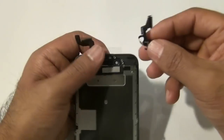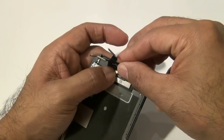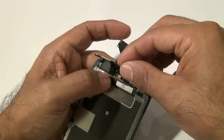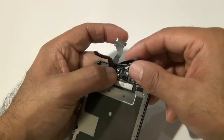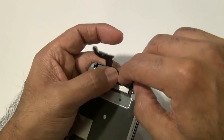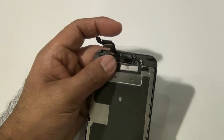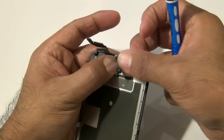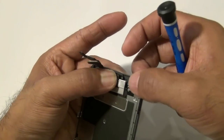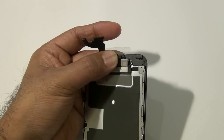With those seven screws in, start working on the front camera proximity sensor bracket. First, lay in the little microphone on the bottom — note there are little hole cutouts in the flex cable that need to line up perfectly with the spots on the back of the front screen assembly. Once lined up, put the proximity sensor into its two brackets; don't force it if it doesn't snap easily. Next, grab the earpiece speaker, line it up, and place the flex cable with its two holes aligned. Then place the front camera into its bracket on the right-hand side, and screw in the metal shield with the three Phillips screws.